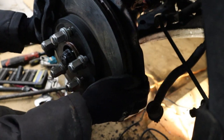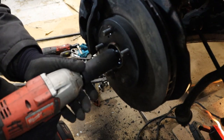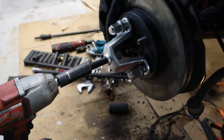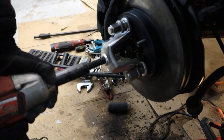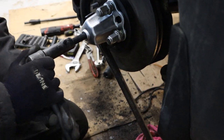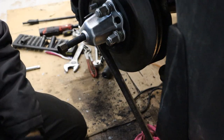Alright, the ball joint and the tie rod are loose. I got the axle to move in and out. The axle nut is actually a 30mm 12-point socket, but it seems like it is stuck inside of the hub. I got a hub puller on there to try to push the CV axle in, but this is giving me too much trouble. So instead I might just pull it out of the transmission on the inner CV side.